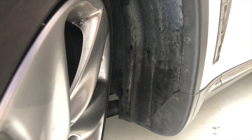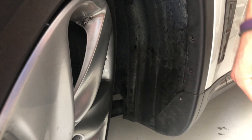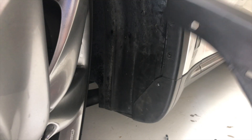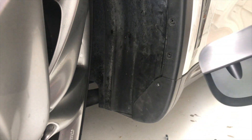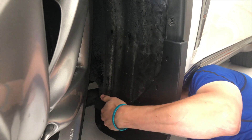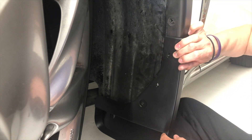First step in this process is to remove these bottom two and there's going to be a third — actually a 10 millimeter on the bottom. Jump to the bolt on the bottom; you'll come down and there's a 10 mil right here. As you line this up, grab your mud guard or splash shield on the inside front left. We're going to line this up, take that 10 mil you just took out, put it to the bottom here and put it back in temporarily so we can line it up and mark the holes exactly where we want them. You're going to have to drill a hole — it's a five-sixteenths or an eight millimeter.